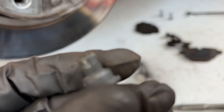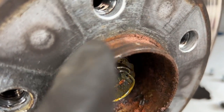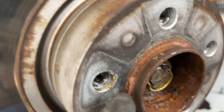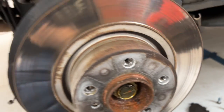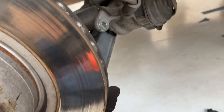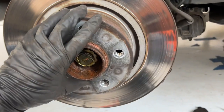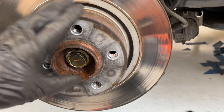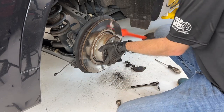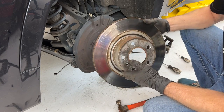Here is our little screw. This one is not too rusty so it wasn't too bad. Sometimes these will be super corroded and rusty — you can see our center here is very corroded. That's why we have our dead blow hammer. I'm going to give this a couple whacks from behind. This side has a heat shield so I can't really whack on it very well, but this side is a little more clear. Be prepared for this thing to come off — it is very heavy, so don't drop it on your finger or your feet.